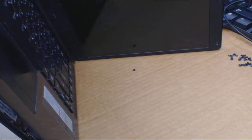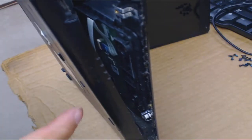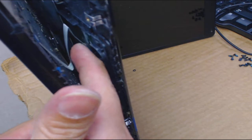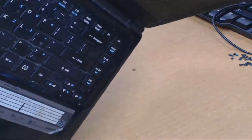There it goes — everything's fine. Another thing to be cautious of is that the trackpad and keyboard are connected by ribbon cable, so you don't just want to rip the cover apart. As you can see the ribbon cable is still connected in there. If you pull this too far you can damage these cables — they're made out of plastic ribbon cable and there's no way to fix a broken one. I might be missing a screw — use caution.